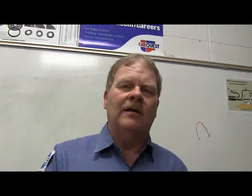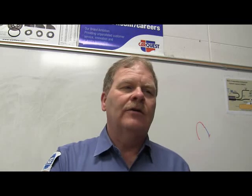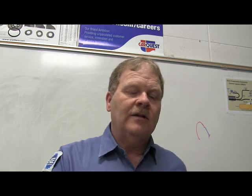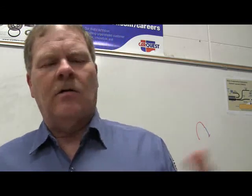If you don't have any operational gauges at all, what are you going to do, guys? What's the first thing you're going to do? No operational gauges, what are you going to do? Use your head. That's smart. Check power by checking the fuse and then, you know, ground. Like I say, you always check what's quick and easy.